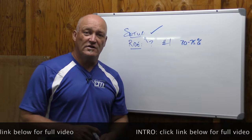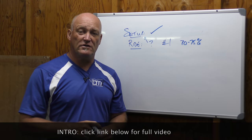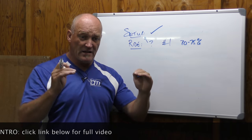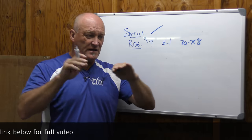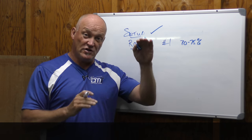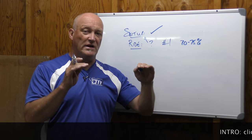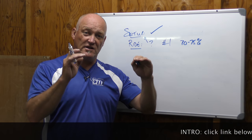Now that we're back and we've done this discovery, we can see how much full fork travel is used. Then we can balance the bike on rebound damping to get it perfectly stable. If we need to make changes based on travel used for preload front and rear, we can make those changes. Once that's done and rebound is set, we're good.